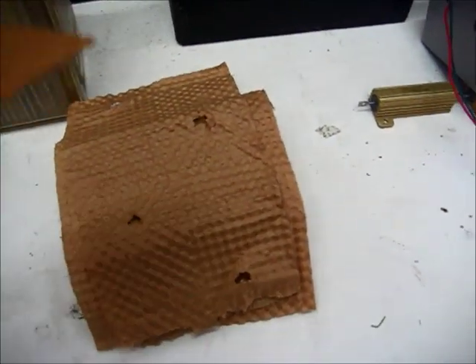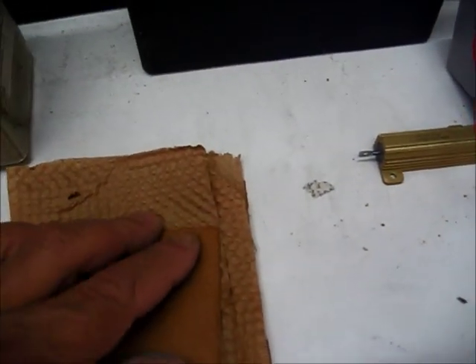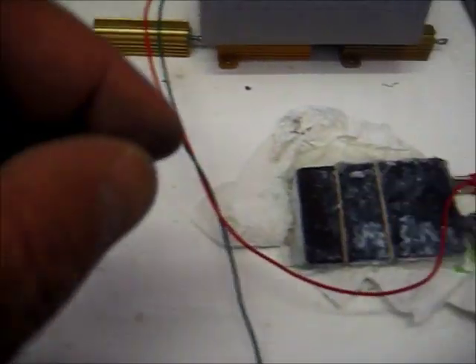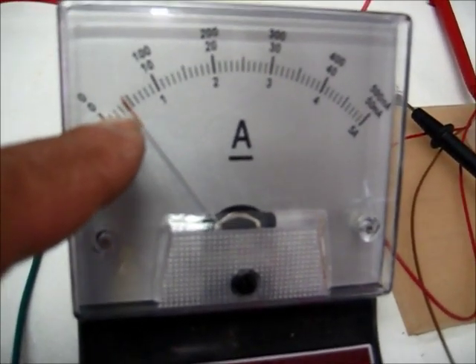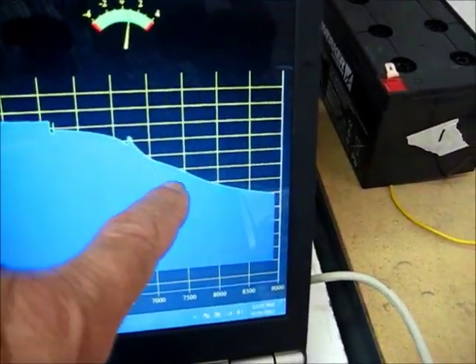So when you put it together, you don't see the light through it. And so the ions and the electrons can just travel right through this with no problem, and it makes a good insulator. But you've got to soak this in the alum first to make it absorbent, and then it's just going to wick from the crystal. However, if you want to use the separators out of batteries like this Willard — this material, see here, you can look at it, you can see the light through it, but it's not too porous. It's just porous enough. So a double coffee filter or a tripled-up paper towel will work just fine in your experimental battery. But here's this one, dried out now, holding about 45 milliamps and doing exactly like a crystal battery.